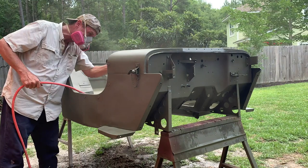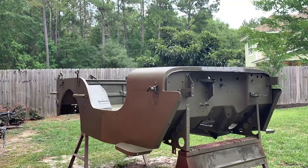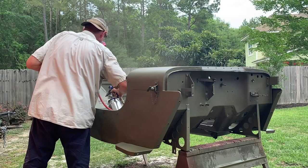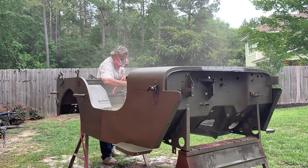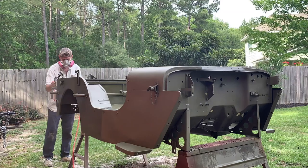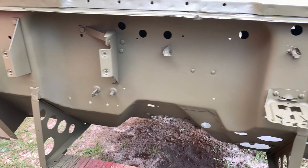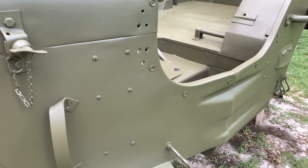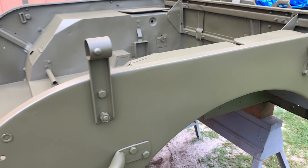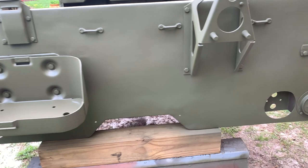As you see here, I'm just going around the Jeep and lightly dusting everything. This is the third and final coat. I've used two coats of Barrier 3 Red Oxide Primer from Ron Fitzpatrick Jeep Parts on everything, including the small parts, before I bolted them all onto the tub. Then I used two top coats of the 33070 Low Luster Olive Drab and let that sit. After it cured a while, I went through with a scuff pad and scuffed every single inch of that Jeep — inside and out, all the little bolt-ons, the parts, handles, and brackets — then washed it down with mild detergent. I had no problem with debris sticking in my paint. The wind was not blowing and this paint dries really quickly. You'll see a little bit of sheen here, and that's okay. I'm ecstatic with the results. Remember, wear your personal protective gear when painting — you don't want that spray dust in your lungs.